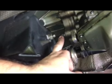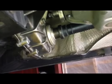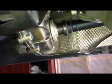Alright, I'm going to have to open the screws from the transmission. This is the transmission, this is the transmission pan, the oil pan for the transmission. I'm going to have to open all the male Torx over here. After I take the mount out, I'll support the transmission and then I'll be able to get to the transfer case. That's the front shaft that goes to the front differential. I think I have a different video that shows how I took the front differential out. I'll get the transfer case out and then I'll explain how to do it. But first you need to take the muffler out.